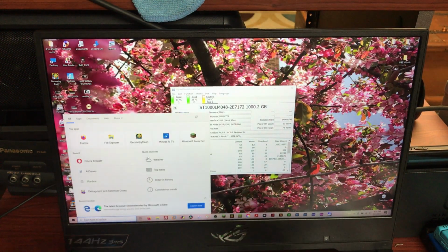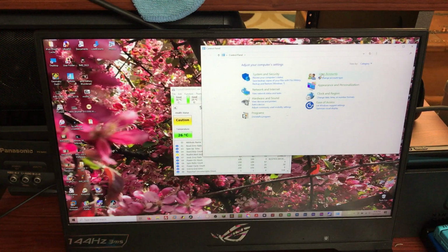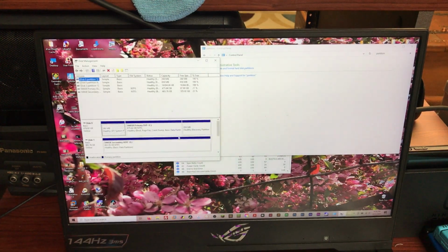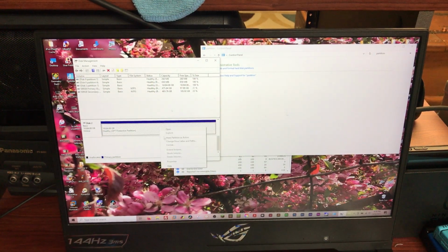Alright, I know this drive is cooked, and no, it has not mounted on the computer, but I'm going to go ahead anyway and try to partition it. I've never seen reallocated sectors get fixed by partitioning it, but I have seen read error rate get fixed by it before, so we'll have to see if it even formats. Either way, I'm putting a new drive in here. This piece of crap drive is... Yeah, it's not even... Made to break.